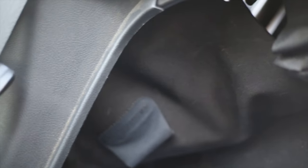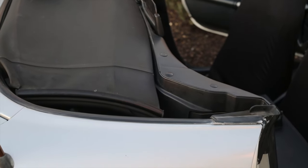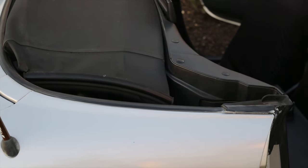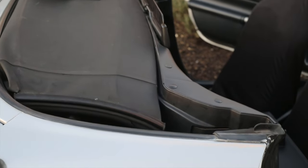Now if you look inside, this little pocket of the soft top is actually where your soft top drain is. Just reach up and pull it down. You can normally have a peek inside, but I don't think this camera is going to fit — just believe me, it's not clean. Now, if you have so much debris that it makes no sense just to pour water in, you should start by putting your top back up so you can get a better look at the soft top drain from inside the compartment.